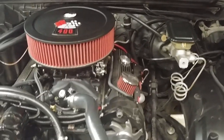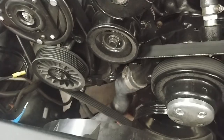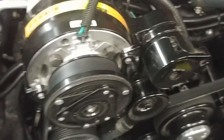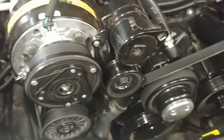So, in the process of actually draining the fuel tank, I've got the supply line disconnected down there by the fuel pump, and I've got the rear of the vehicle jacked up about half a foot or so higher than the front of it, and it just siphoned. I've got about 12 gallons out so far, so I think I'm pretty close to empty. So once that's done, we can drop the tank tomorrow and take care of that.